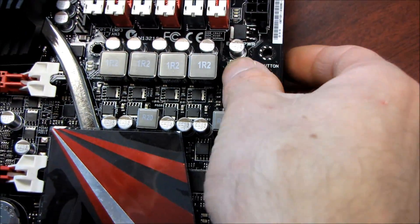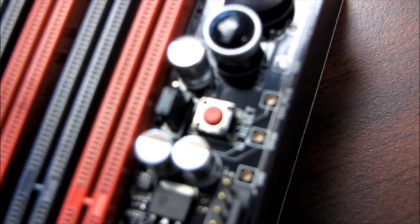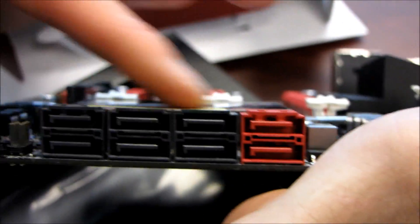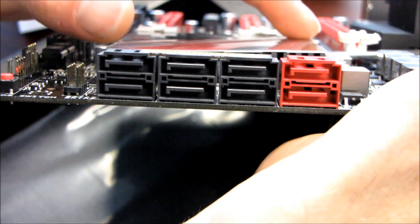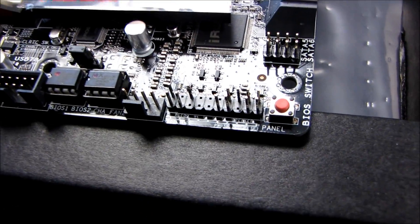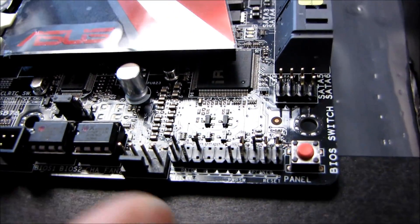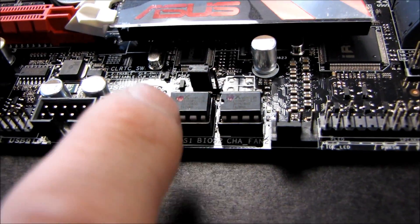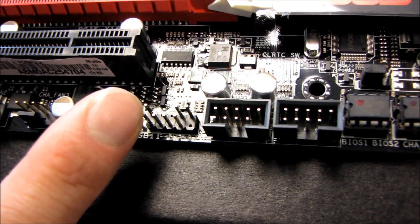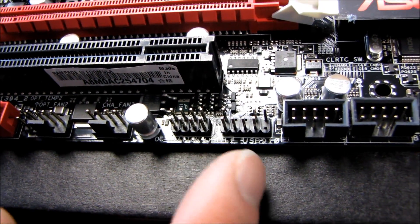Down here we have the Go button and a Q Reset button up above. Moving down the board to the SATA options: we've got six SATA 2 ports — Intel still does not natively support SATA 3 on their chipset, so it's actually a Marvell chipset running the two SATA 3 6 Gbps ports. There's also a BIOS reset switch here, though it's less conveniently located than the one on the back panel. Here are your front panel connectors, another fan connector, and your dual BIOS chips — two actual physical chips you can switch between, not some cheap hack. You've also got front USB ports and a Firewire port.